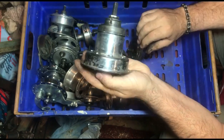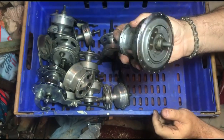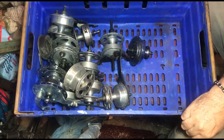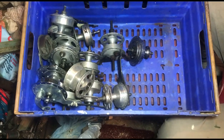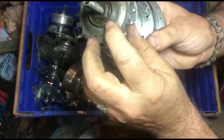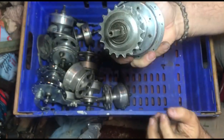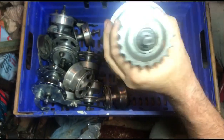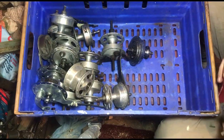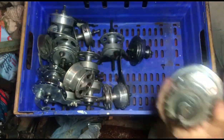This one is more likely a 36-hole - no spoke count stamp, a bit later. It's a 1961 FG - F for four, G for generator - February 1961. Now looking back at the 1950 hub: it has the screw-on freewheel - it doesn't have the three tabs and the retaining circlip - so that's the earlier fitting. Only a year later in 1951 and it's already got the fitting we know nowadays. Watch out for that if you think you're just going to swap a sprocket over.